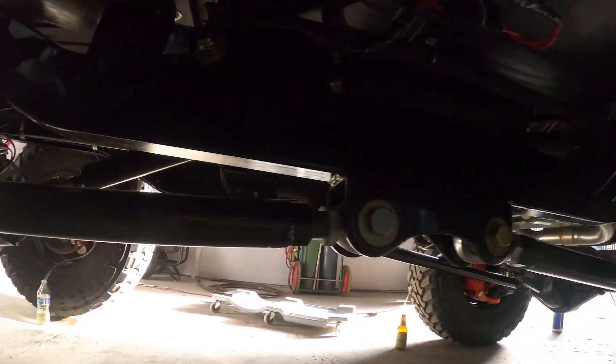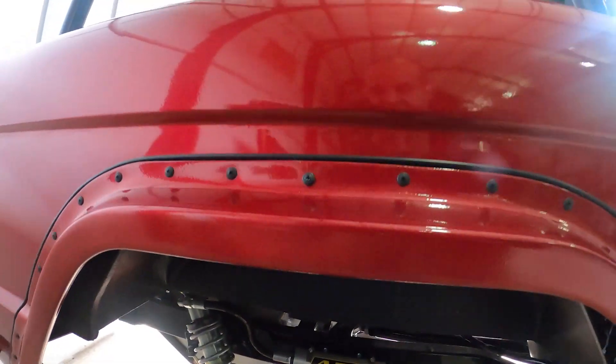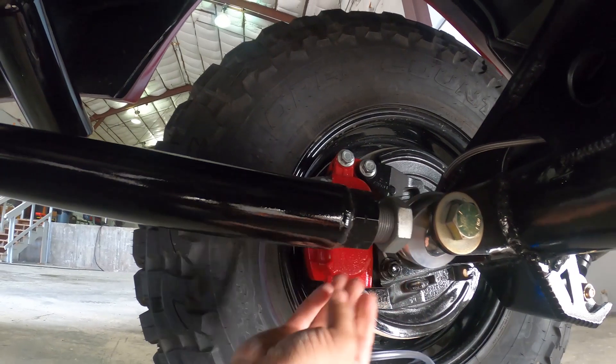Obviously none of this stuff has been adjusted - the coilovers haven't been adjusted. We literally built the body, put it on the chassis, finished it for the wedding, and it's just been sitting ever since. But we want to make sure this thing's right before we sell it. You can see now - this thing is almost perfect. So we just got to tighten the jam nuts, and we'll call that a day. There's some tightening happening right there. We'll call it good and get on these brakes real quick and get out of here.